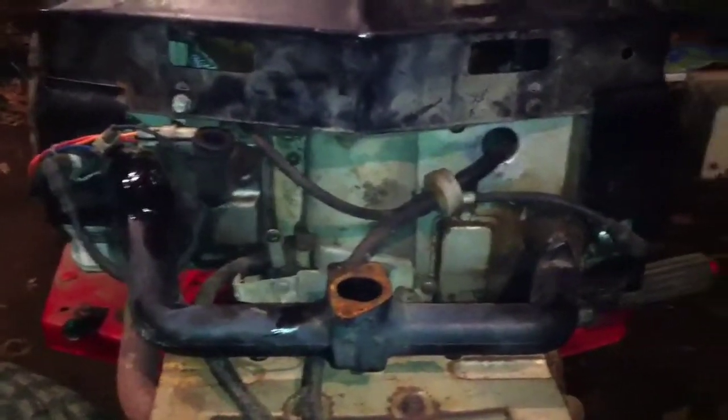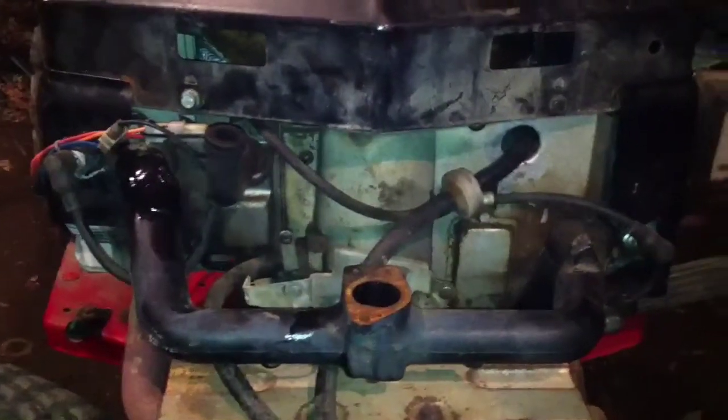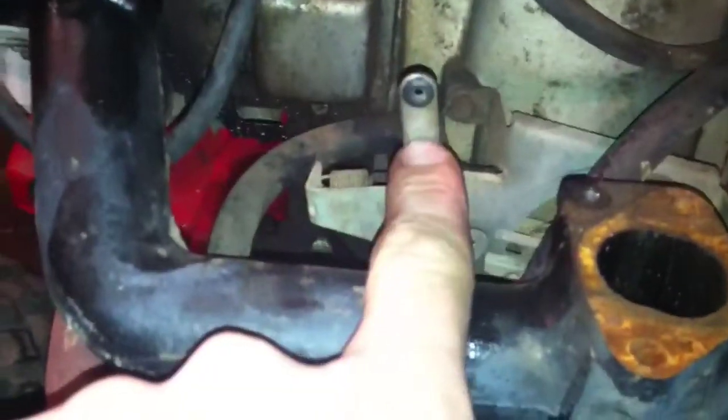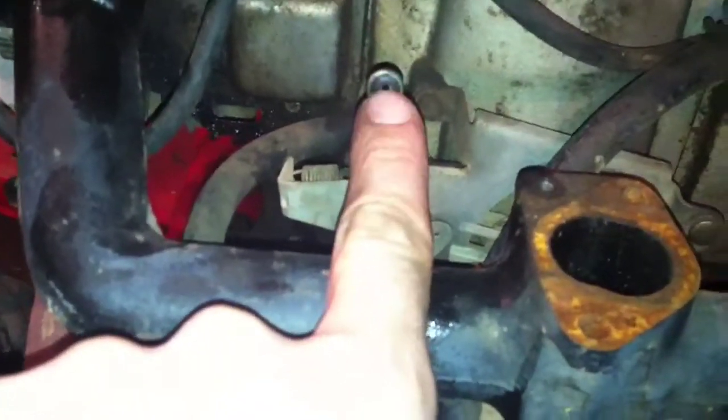I've already got my piece of handlebar mounted ready to go. I went ahead and did my shifter - I got it turned up. I used a deck engagement lever from a wide-body Murray; it slips right over the original shifter and I just drilled a hole and put a bolt in it. Alright, let's pull the hood off. We've got the carb off, all the carb linkage, fuel lines, fuel pump lines and all that off - we're down to the governor.